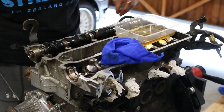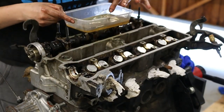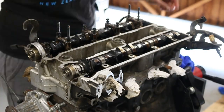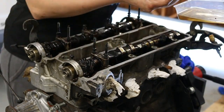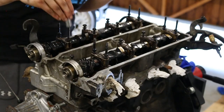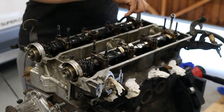The process to reassemble is more or less backwards. Lubricate everything generously before reinstalling all of the components. The camshafts should feel snug and almost slip into the correct position — if you're unsure, just twist them around until they feel like they fall in place. With the cam caps, make sure you reinstall these both in order and facing the right direction. I started the threads by hand, making sure everything was finger tight first, before tightening these down a few turns at a time so as not to warp or put unnecessary strain on the camshafts.